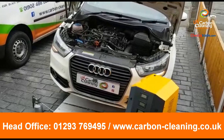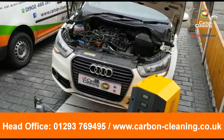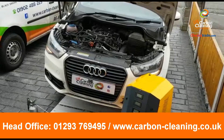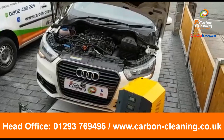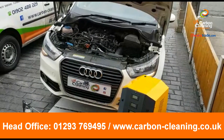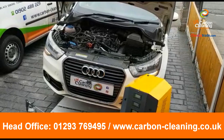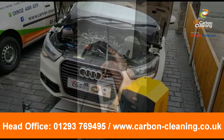The customer left the vehicle with us, because when we initially went and done the diagnostics check, I looked into the DPF and the sensors, and it actually turned out the DPF was blocked. This vehicle didn't actually show any signs or any fault codes relating to the DPF, but when we looked at the live data on the diagnostics, it turned out to be really bad.